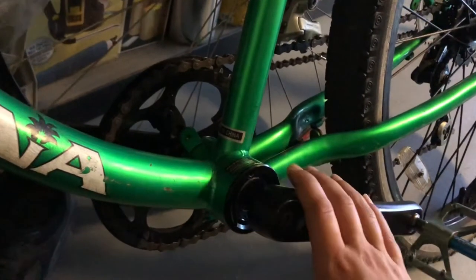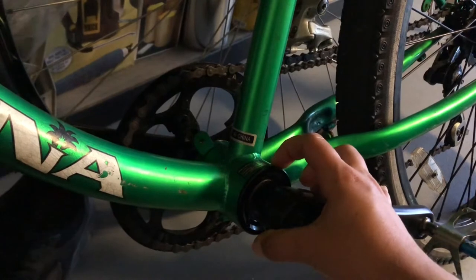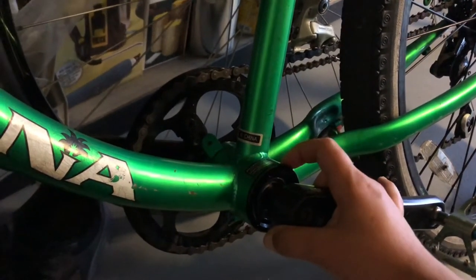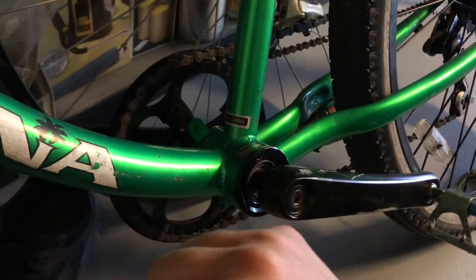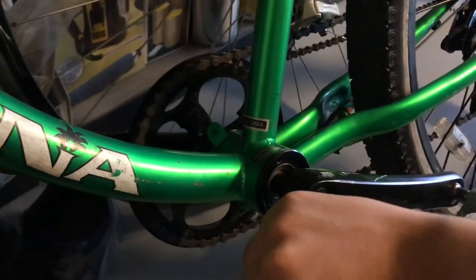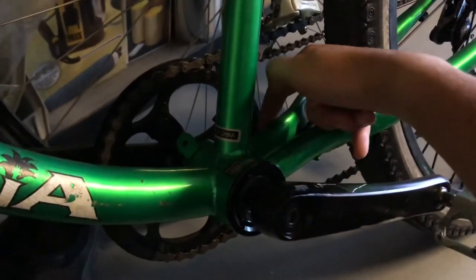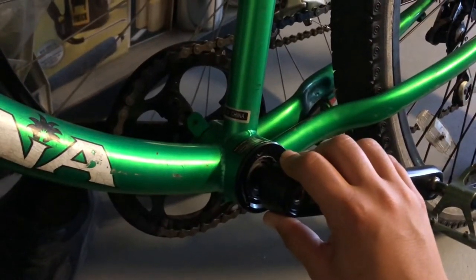So that's all installed, greased up, and cleaned. I knocked out the inside cups — they were a little bit of a pain to pop out. I normally use a wooden dowel, put it on one side and pop out the opposing side — just lay it on the ground and put some wood there so you're not bouncing off the tires.